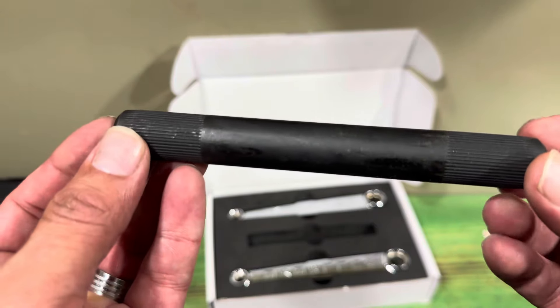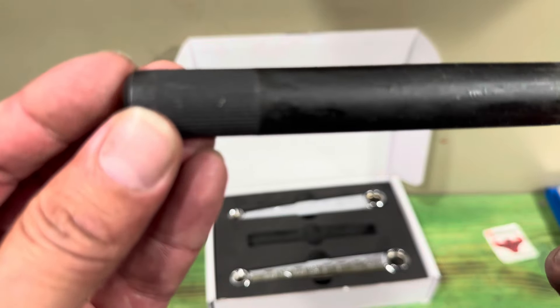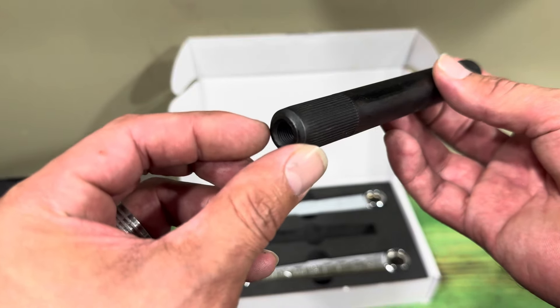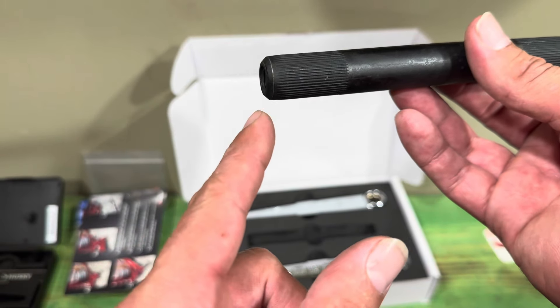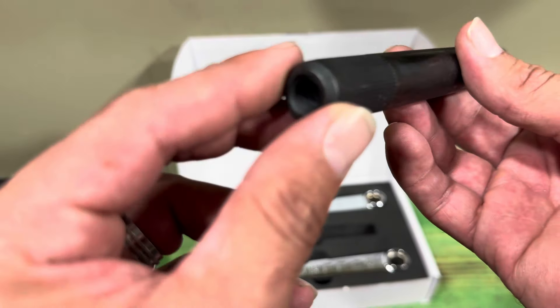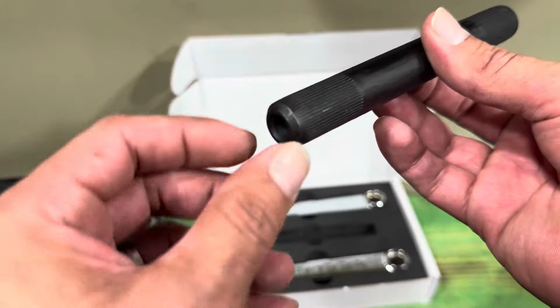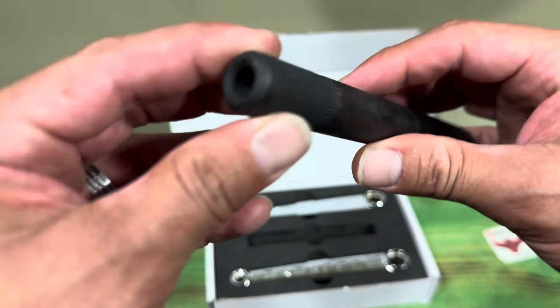This spindle is a little bit different than others I've seen. Right away I can tell it's a little longer than most 48-spline spindles. It's actually machined down on the end — a lot different than most, which are pretty flat. This one is chamfered quite a bit, which probably helps the crank arm slide on a lot easier. I think that's pretty cool.